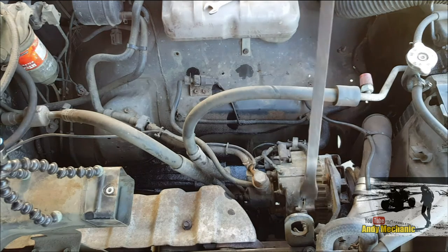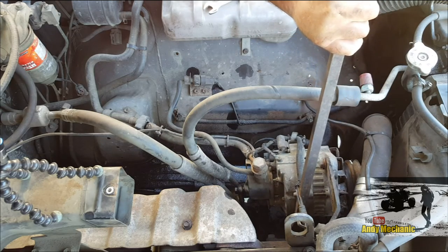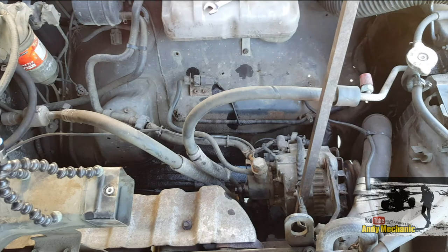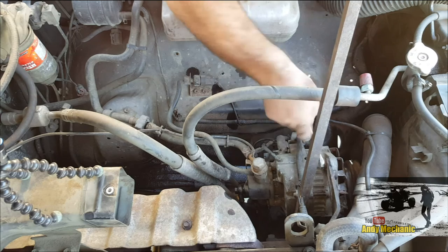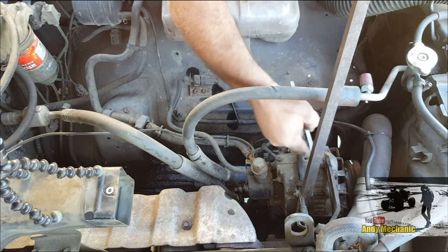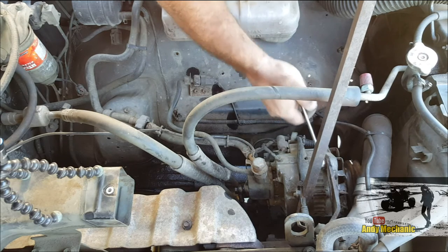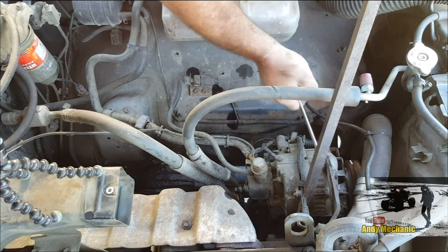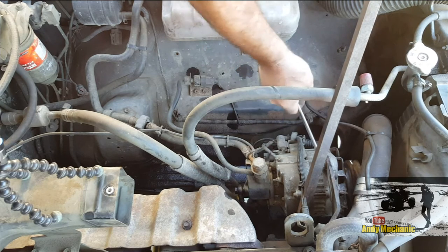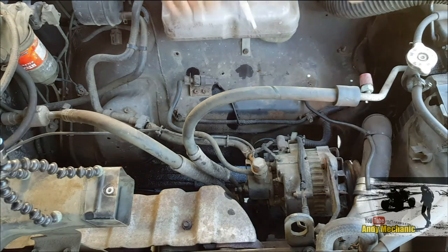Time for a big bar. Now, I know this belt's about done, so all I'm doing is running it straight to the stop on the adjuster and tightening it up, because it's going to need a new belt soon — it needed a new belt about a year ago actually, so I'll get one later on today, I promise. Let's just tighten that up. Now, once you've adjusted it, then you can go down and tighten up the two pivot bolts at the bottom. Best to leave those just a little bit slack whilst you're doing the adjustment — makes it a lot easier.